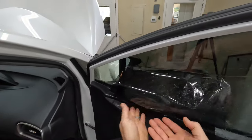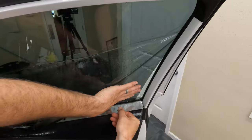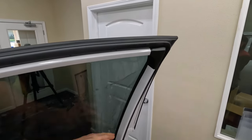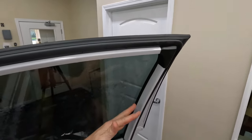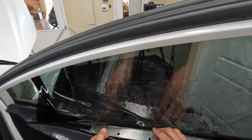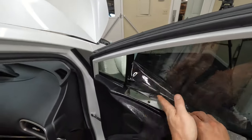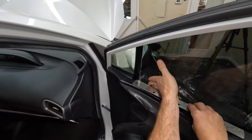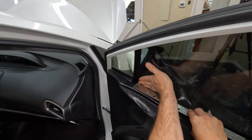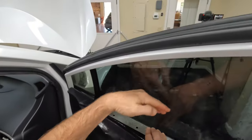Now we're going to have to kind of hold the film out so that it doesn't rub all over the door panel. With the gasket wizard all the way over there, we'll go ahead and make this angle here and make the film sit nice and flat. I'm just going to go ahead and roll that under and towards the glass so it's not just flapping and hitting the panel. We're going to try to keep this as flat as possible and just slide it in there — that'll give you the least amount of kinks while you're trying to push it in and messing with the film as little as possible. You can see I'm just kind of guiding the film down in there, and now we need to get this piece of film flat up against the glass. It did come up a little bit high up there, so we're going to have some air pockets to deal with up there.